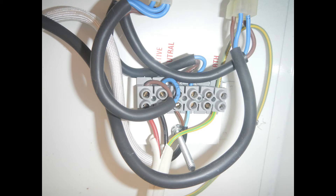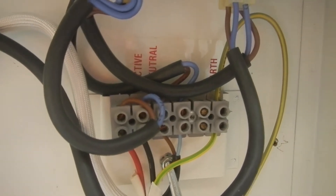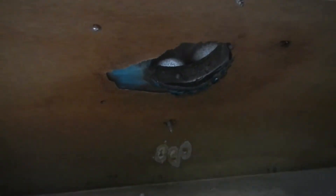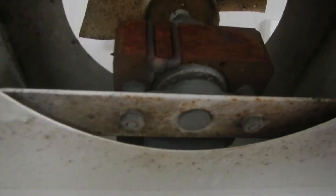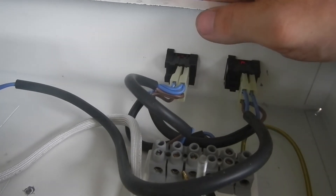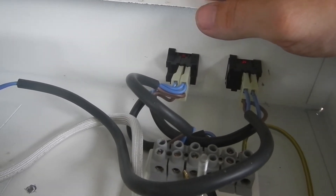The good news is there's no transformer or anything behind here — it's literally just another one of these little junction boxes they use. Jayco seems very happy to use these things; I'm not particularly happy with them. I prefer solder or shrink wrap, given the option. When you do pull this out, just keep in mind that the 240-volt wire comes in the back, and you can see it going off over the top there, so that is going to hang down. So this is our little range hood out. There's a little vent that it goes out to. When you do pop these out, keep in mind you're going to have wasps and all sorts of stuff in here — this whole section here was all covered in wasp nests. There's our little fan motor. Hopefully just those two bolts and we can undo that and it'll pop out. We're going to see if we can use these switches as well — keep it looking a little bit factory.